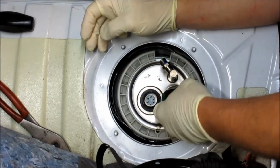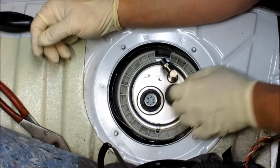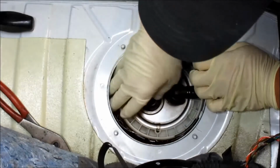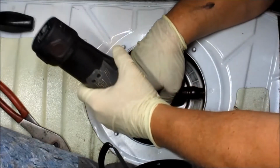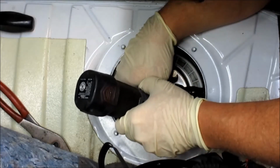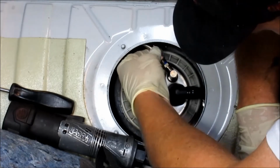At this point we can go ahead and stick the evap line on, and to do that you got to pull it sideways to put it in. That locks down in, pull it back and forth. That's good. So now there's a little spot right inside here for your tool to go, for your ratchet and stuff to tighten this up. I'm just going to use the electric one because it's a little easier. Nice and tight. Okay, now we're going to put the fuel line on.